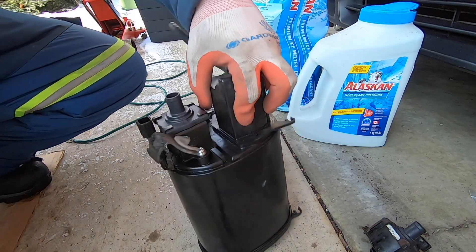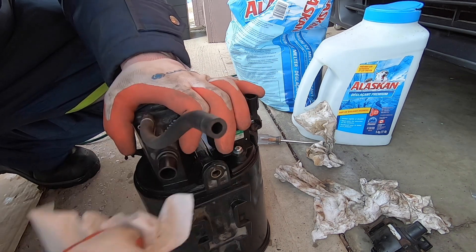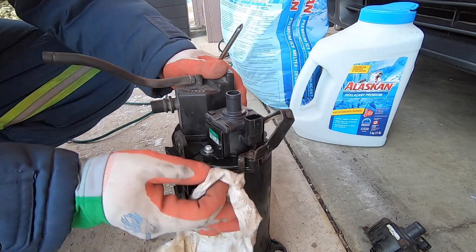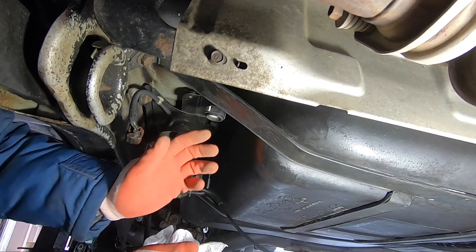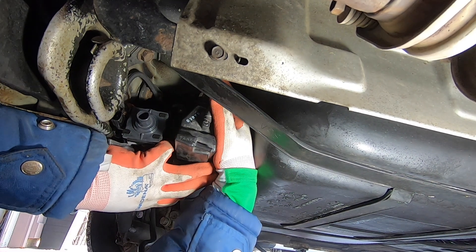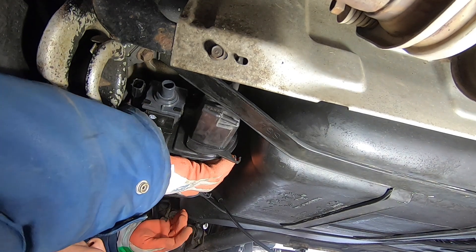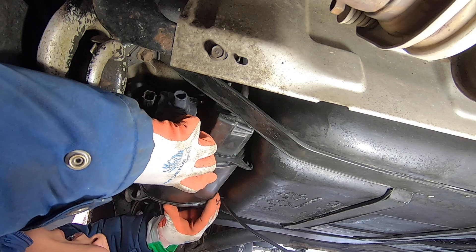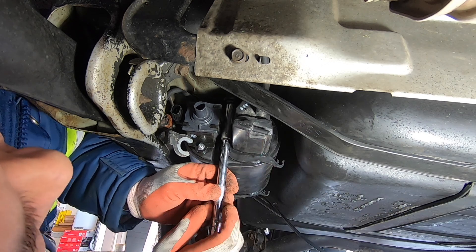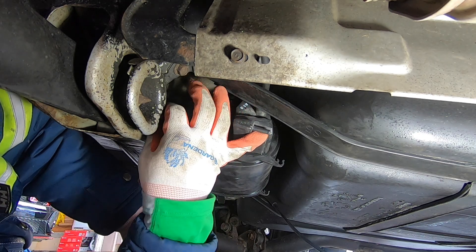Just finger tight — there's an o-ring on that stem so it's not going to leak anyway. Make sure the nipples and everything are clean prior to reinstallation. Wipe the canister clean and then reinstall it in the car. Make sure all connections are clean, carefully reconnect the hose by snapping it in, find where the tab goes on the canister, fish the bolt up into the hole, and just snug it — it doesn't have to be crazy tight, this thing doesn't weigh much. Reconnect the electrical connector and snap that on.